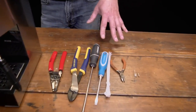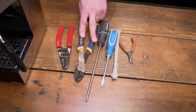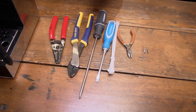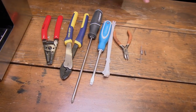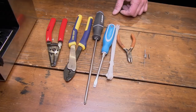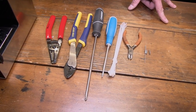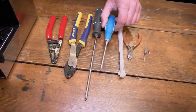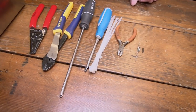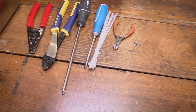You just need a few tools: wire strippers — any kind will do. We need a wire butt connector crimping tool to make crimp connections for butt connectors. A Phillips screwdriver to take out two screws on the top panel. Just in case we need to remove some wires, you need a flat blade screwdriver. We also need to remove the bracket around the button control on the front of the machine to get the wires out of our way. Some zip ties, and a little cutter for cutting the zip ties and trimming the excess when we put new ones on.